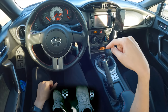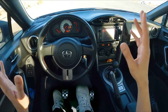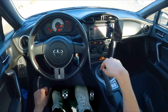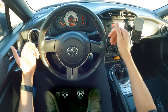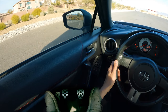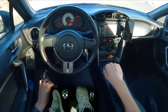One other quick thing: in an automatic transmission vehicle, you can put the gear selector into park and let go of the brake, and the car doesn't go anywhere. Stick shift is different. I have my handbrake enabled because if I have my feet off the brake and I'm in neutral, the car can roll — and you can see the car is rolling slightly. That's why I have the handbrake engaged.